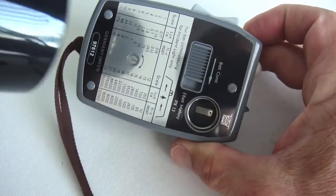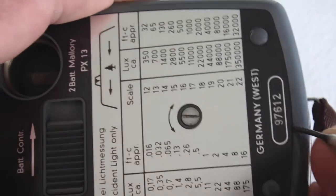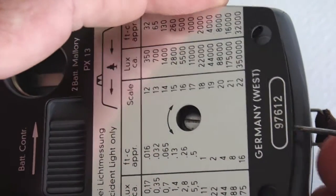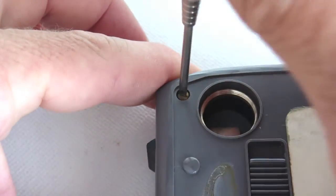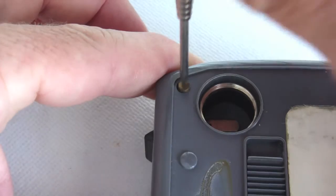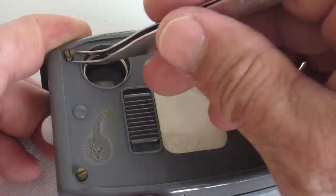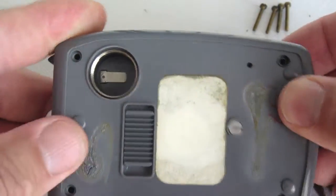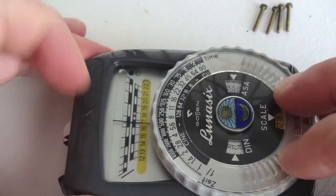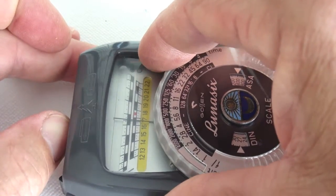The back cover plate glue can be softened with a blow dryer on medium heat, or you can have alcohol seeped underneath to dissolve the glue, or you can just pry it off. Four screws retain the back shell in place — remove those with a slotted screwdriver of the appropriate size, then slip the screws out and separate the shell after you turn the casing over.